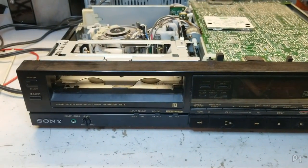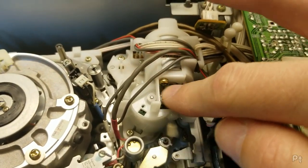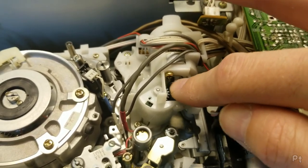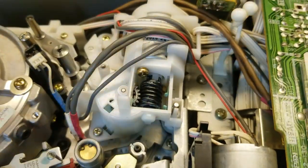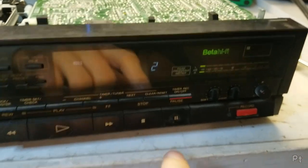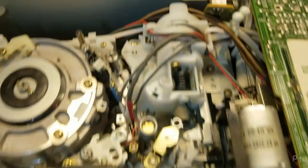And it doesn't work. Let me show you what it does. Just plug it in here. You can hear the motor spinning, and it's trying to move — now it's trying to move this way. So it's moving the tape guides that load and unload the tape, but you can hear it free spinning. And now it just times out. It won't turn off — it's stuck on, basically faulted out, locked up. Won't do anything.